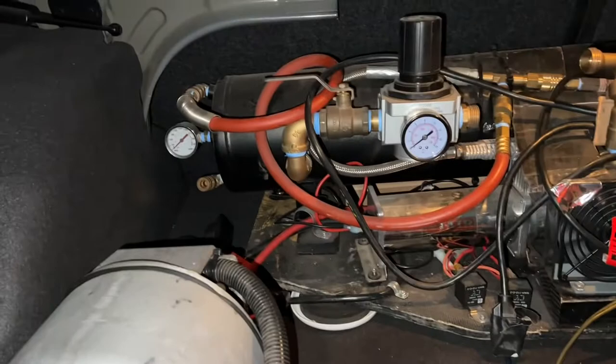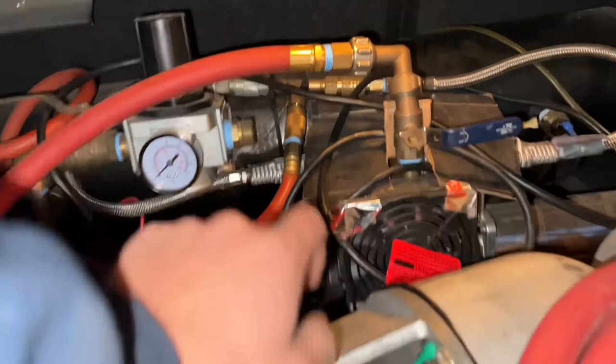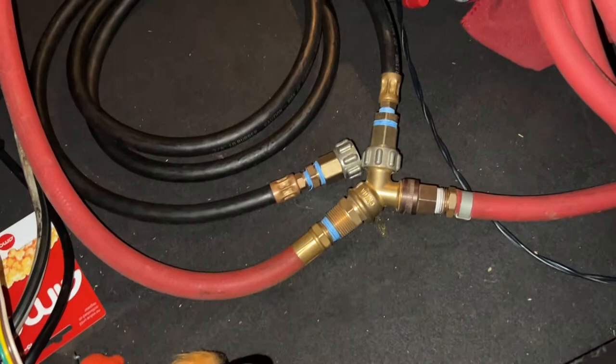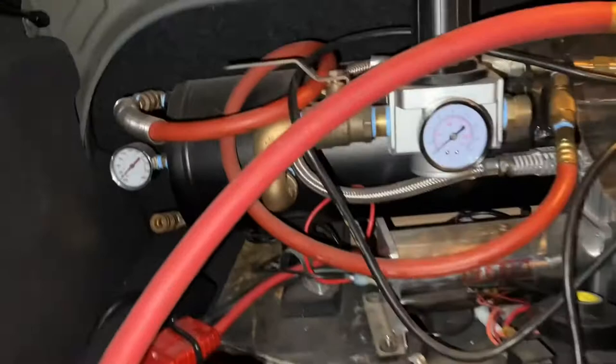Now that the Y is in place, this is just your half-inch right here. That goes to the ball valve, which I usually have off. But if I'm going to be doing runs with my full setup, that's when I open it to the whole system. If you're adding supplemental tanks like what I have here, everything does not have to be half-inch — in this case, this is a 3/8-inch airline. Of course I have a couple of adapters with garden hose fittings. The only thing that has to be half-inch is everything leaving a tank going through and out to the horn — half-inch or larger.